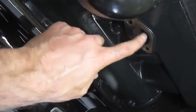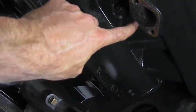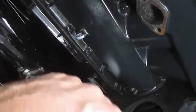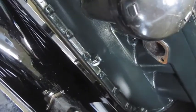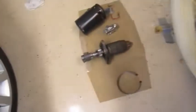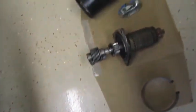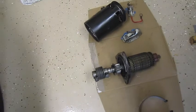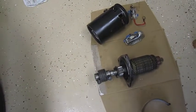You can see I sanded this water inlet down a little while ago and there's already some rust. Anytime you have bare metal exposed on your Ford Model A engine, make sure you protect it, paint it, or something — don't let it sit too long. That's all I have today covering the Ford Model A starter motor.